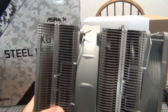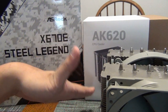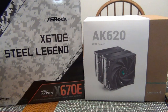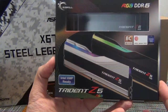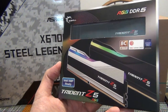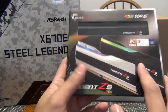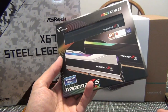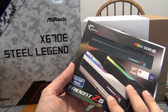This is what the D14 looks like. But Deepcool has a newer convex mounting plate in terms of how it sits on the IHS, so we'll see if that results in better temperatures. For memory, we're going to be using Intel XMP Trident Z5 RGB — not the Z5 Neo — mainly because this is two sticks of 48GB, so the total of this kit is 96GB total across two DIMMs.